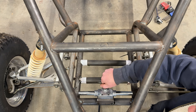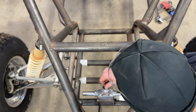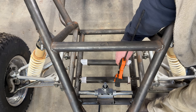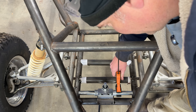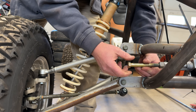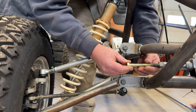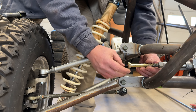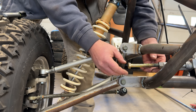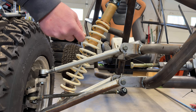Next, center your rack — we are doing steering geometry, so the better we have it set up the better it's going to be. It looks like it's going to be three and a half inches per side to center it. I'll add a couple of clamps to make sure it doesn't move while we're working. Now we have our bolt, and remember we want adjustment — three threads minimum. From there I want adjustment in and out, so I'll use that measurement to build the rest off of.